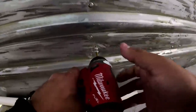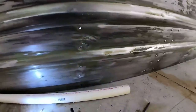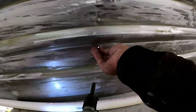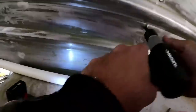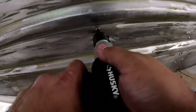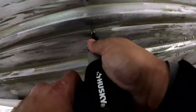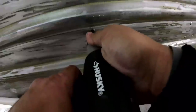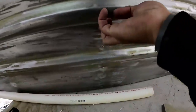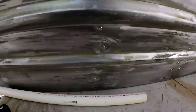We are drilling out the terrifying closed-end pop rivets — look how weak it is. It comes out that easy; imagine if it just hits like a rock. That's it for it. The buck rivets are much stronger. In hindsight, the advice the Home Depot rep gave me — to cut the head off and turn it into a buck riveting tool — did work, but I'm sure there are better tools out there. I've seen people do it within seconds and the rivets aren't all flat on top like mine. You can also crack the hole if you buck it too tight, so I was paranoid about that.